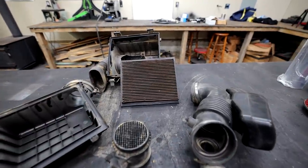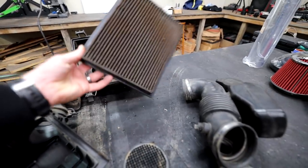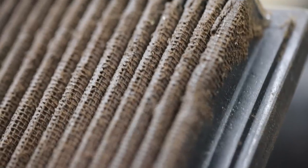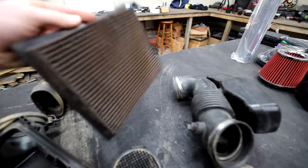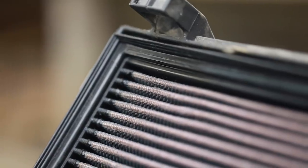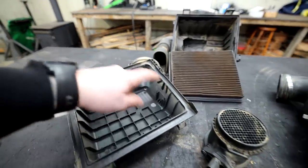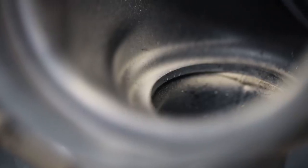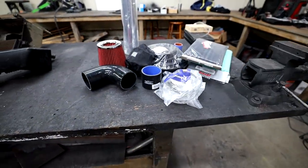Last summer I took a 7-day trip with a bunch of friends down in Southern California. Where I live in Washington it's very wet, but we don't have problems with plugged filters because it's not that dusty up here. But in Southern California it completely plugged the filter — it filtered just great, but it plugged so bad that air started to pass around the seal and it coated the inside of all my piping between the air filter and the engine with microscopic dust. We know that a bunch of microscopic dust got into the engine, and long term that's a huge problem — it's basically sandpaper on all those moving parts and will wear things out prematurely.